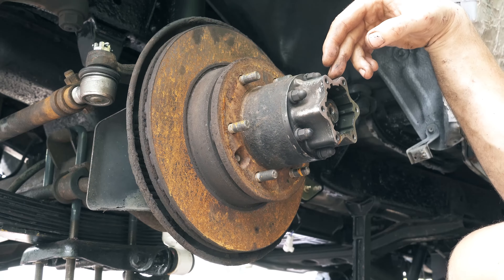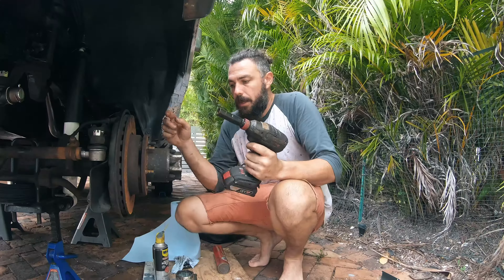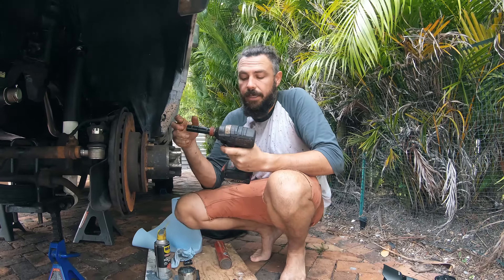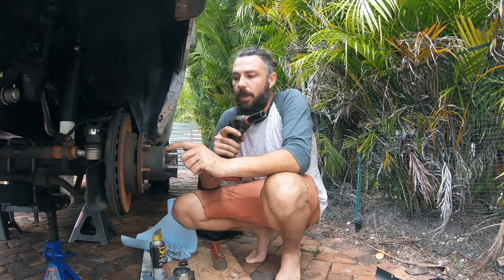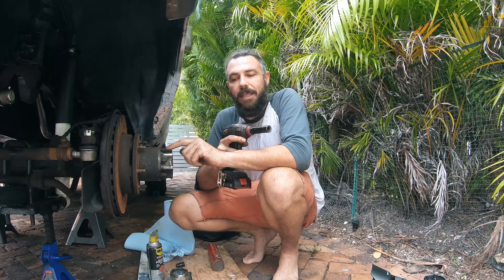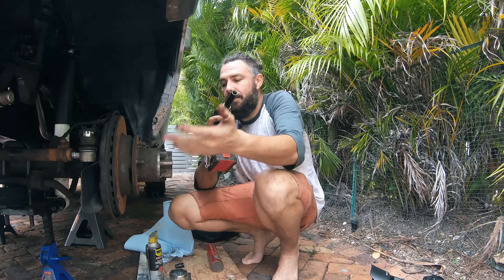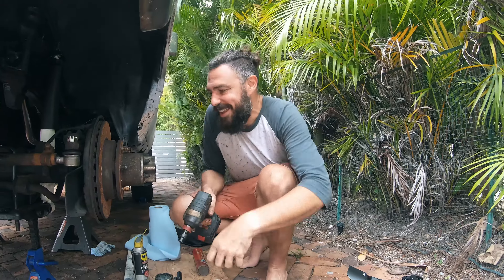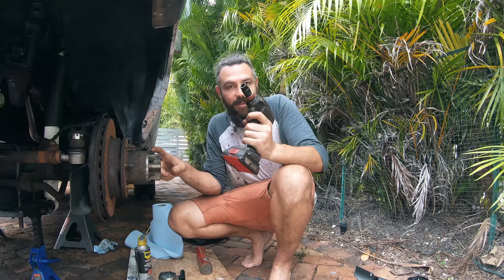There's actually not a lot of grease in here — there should be a lot more, so we have to make sure we pack this with grease when we put it back together. The next set of nuts you want to take off with a 14 millimeter. I struggled to get these off on the other side yesterday by hand, so I'm going to use the ratchet. If the brake calipers were still on you'd be able to get these out a bit easier, but I'm going to use the ratchet because I have no way of locking this out and stopping it from turning.